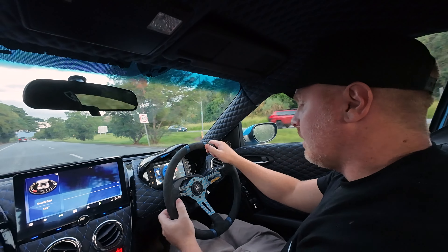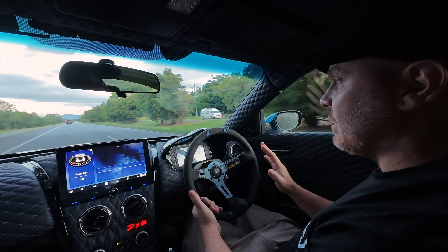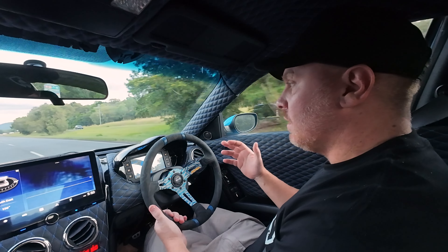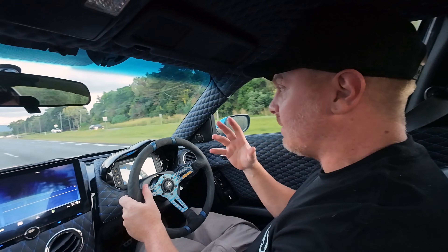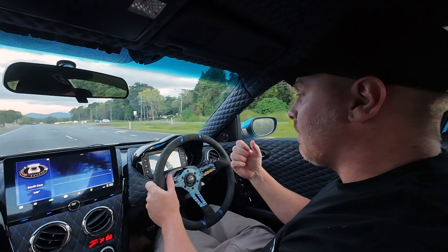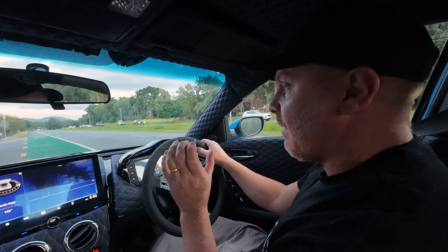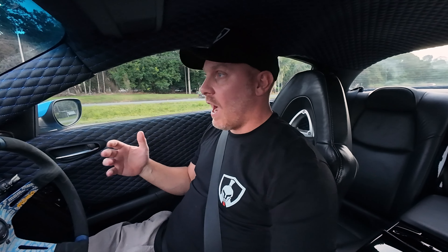Another thing about this clutch setup — we're in fifth gear doing 80 km/h on the highway, and if I'm just feathering the throttle we get a lot of jerkiness in the car. This is mainly because of the bridge ported engine, but also because the lighter flywheel doesn't have enough mass to absorb that jerkiness. The spring size inside the hub, their travel, and how much pressure they can absorb would also be contributing factors. But the main thing is we've reduced a lot of rotating mass, which makes everything easier to jolt backwards and forwards.